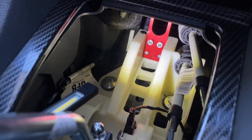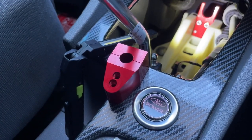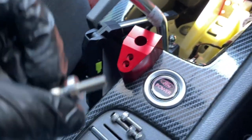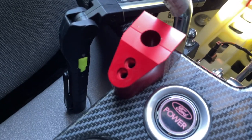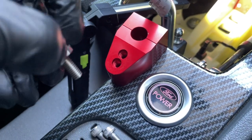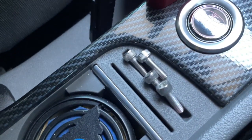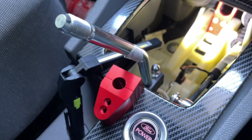Now to add the other piece. I've disassembled this piece to show you — the top half of the short shift kit has a little ball joint that replicates the one down there. There are two placement spots: the higher it is, the shorter the throw. I don't want it super short, just a little bit shorter, so I'm going with this hole here. I'll put a bit of Loctite on this one and on the four screws on the back.